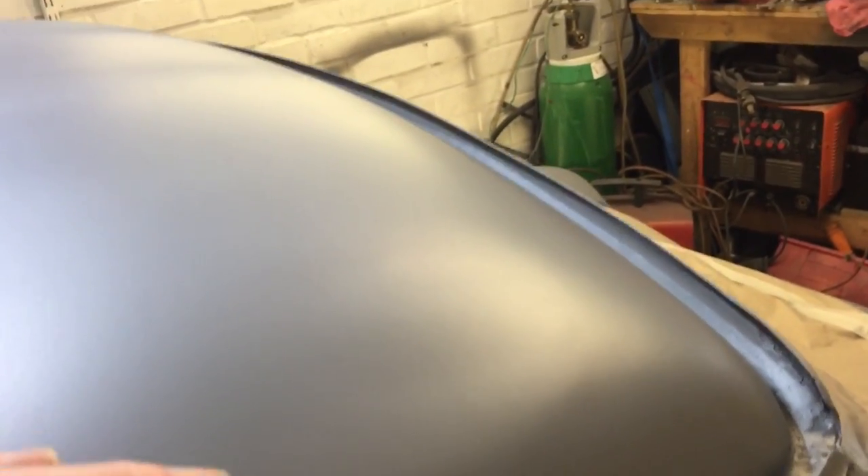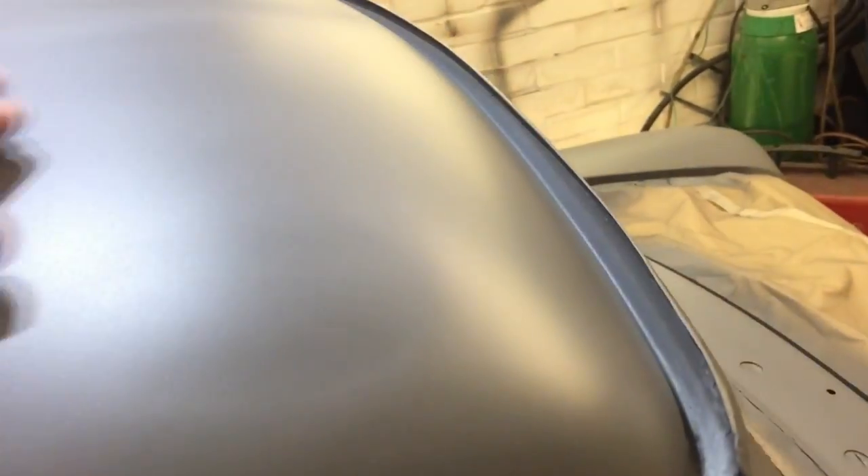This is the roof now - I'm going to try and show you some of the things that have gone wrong. Just here, something's happened - I don't know if it's where the filler is or where it's bare metal, it's just reacted slightly. Also gone a bit speckly around where I've done the filler work. I think that's mostly water got in there, so we're just going to have to rub that away once it's all dried off. Overall not too bad. Down at the front there's maybe still a slight dip - it's just sunken a little bit into the filler again. Hopefully once I rub that down it'll go level - probably just the first few layers of filler primer sinking into the filler.